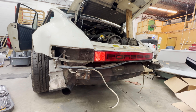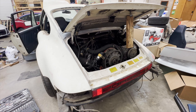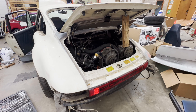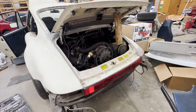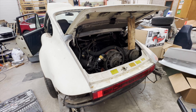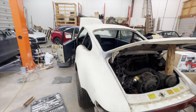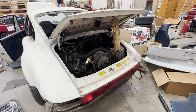She's a non-firer. I need to check for spark, I need to check for fuel. I kind of got my hopes up, but I'm not surprised that it doesn't run — sounds like a lot of them do when they don't run. I didn't bring my spark plug removal tool that I like to use. The car was building oil pressure though, which is a good sign. The fuel pump is probably trashed or something with the sending unit.